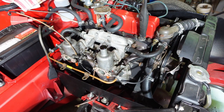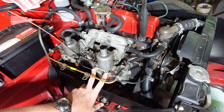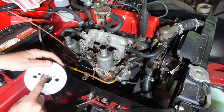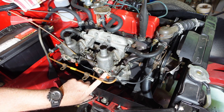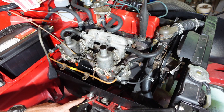Carbs are back together. I didn't find any smoking guns. The jets move freely with the choke — that seems to be adjusted fine — though whether it's tuned properly is a totally different story. I wanted to point out on these air filter gaskets: there are holes for the bolt holes, and then a hole that's actually in the carb and one that's blanked. When you put the air filters back on, you want to make sure the holes are aligned to the top of the carburetor so you have communication through that line. I'm not exactly sure what that port does — maybe an equalizing line for the piston — but just make sure it's lined up properly. I don't like to run the car without air filters, and we'll move on to timing next.